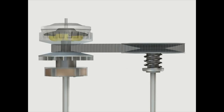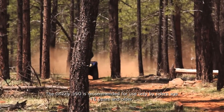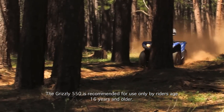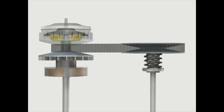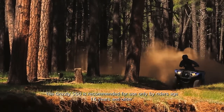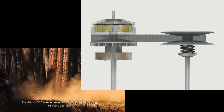Starting at a low initial range to accelerate the ATV from a stop — like first gear in a manual transmission — then to a higher drive range, allowing the ATV to achieve a higher ground speed while maintaining the same engine RPM. As the drive clutch assembly is being forced together during acceleration, the driven clutch sheaves are being forced apart as the ATV begins to accelerate and the engine power overcomes drag and friction. This is referred to as upshifting.